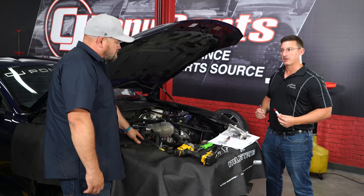Now do some wiring for the pump. Connect the harness up to the fuse box, plug the pump in at the bottom, and bring the ground wire over to connect to one of the factory grounds. The rest of the harness gets fished over to the other side of the motor to the EVAP connector — run it around the back of the blower and hide it with the existing wiring.